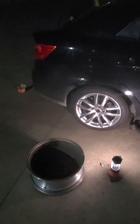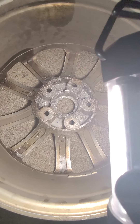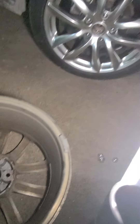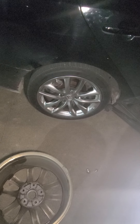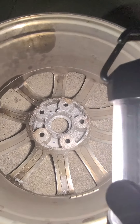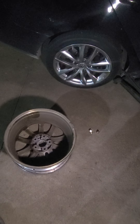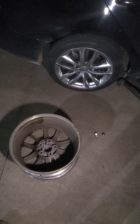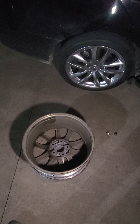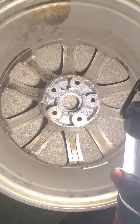There are some small differences between Nissan and Kia, starting with the center hub bore. I had to grind it out a little bit. The easy way to do that for me was to bolt it on and send it home with some ugga duggas until it sat decently and it put a nice little crease in here. You won't see the crease anymore because I've grinded it out. The hub bore difference is only from 66 to 67 millimeters, so I only had to grind about a half mil of material off of each lip there.